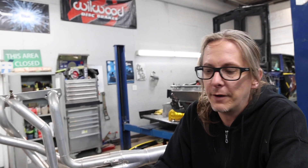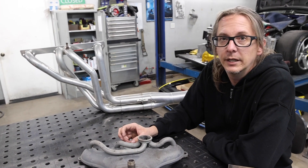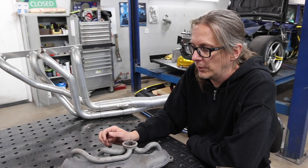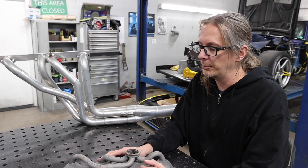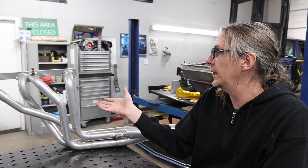So it's like anything else in custom cars and performance cars — it's a lot of a balancing act. If you've got a package that you just can't fit a header, a manifold's the way to go. If you're looking for a manifold, you really want to look at one that's going to have the volume that you need and it's going to have as good a flow as possible, as wide a radiuses as possible. If you can find one with longer primary tubes, most of the time that's going to help if it'll fit your package. If ultimate performance is the goal, you're almost always going to need to go with a header, because you're going to be able to tune that to your engine and make everything work optimally.